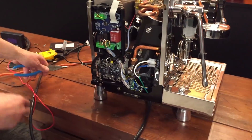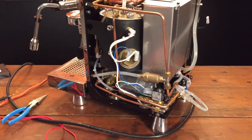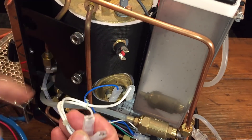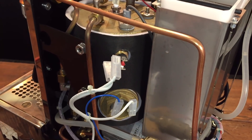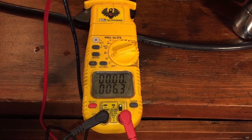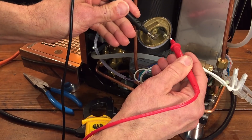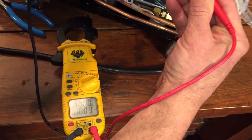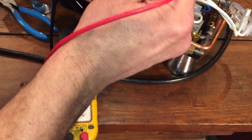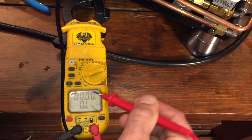Now let's look at the boiler on the other side — the steam boiler. This is easier to access. If you want to check your high limit there, you can pull these two wires off and just take your meter and put it right across — you're on ohms, so almost no resistance, that's good. And then if you want to check your heating element, you can go right across it without having to use any extra wires. We've got 11.4 ohms — so that heating element's good. Again, if you want to check for tripping breakers, put one wire on the copper — in this case brass — and the other to the heating element. There should be nothing, no continuity.